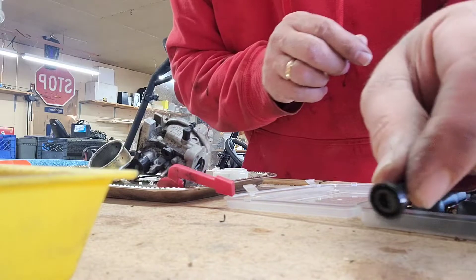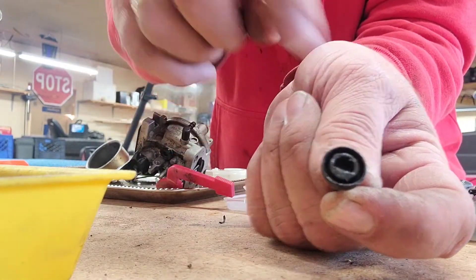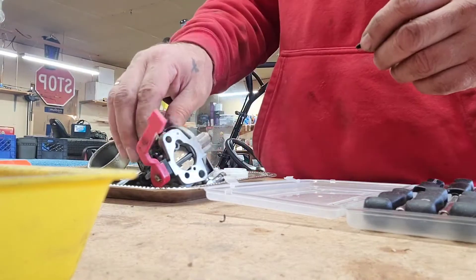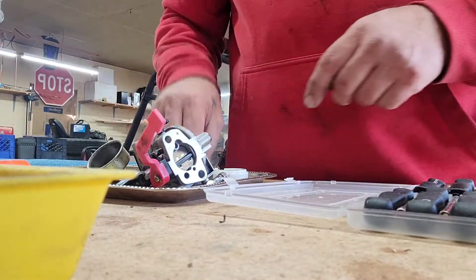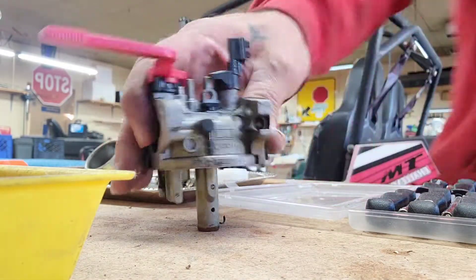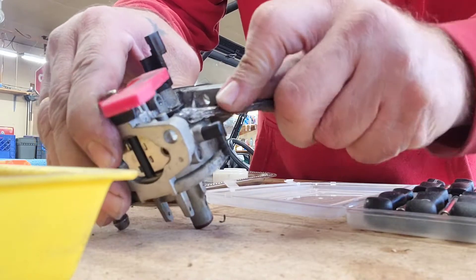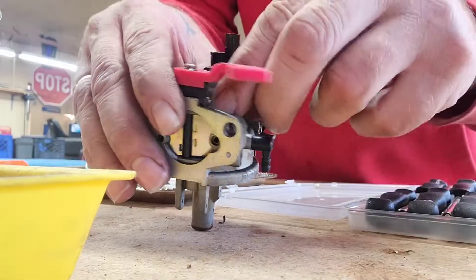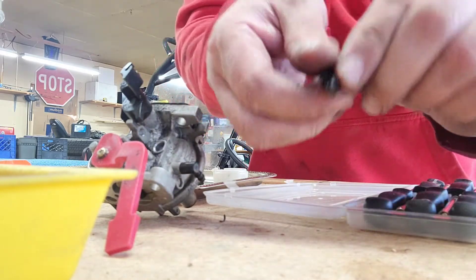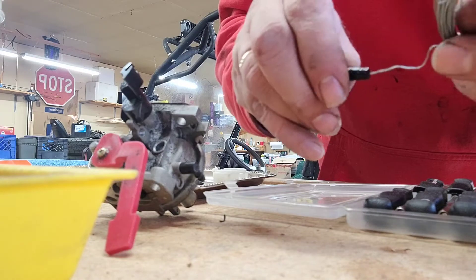There's a tool for this — I don't have it in this kit, but this kit is mainly for doing weed whippers with those special screws. This right here — take that out. You don't have to clean that one, but you do have to clean this other one. Take a flathead screwdriver and pry up on there to get that little jet out. That jet is always plugged up — let's look and see if it's plugged up.